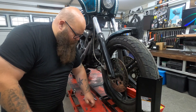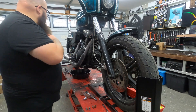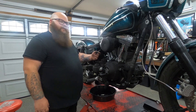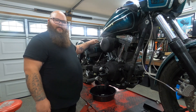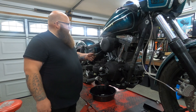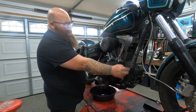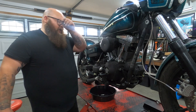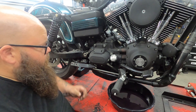It's important that you keep all your hardware together — pay attention to where it goes and don't misplace or lose stuff. We got the exhaust off. What I did was take the O2 sensor off the pipe rather than trying to feed the clip through the frame. I remember when I was putting this back together before I had the hardest time getting it fed through, so I just took it off the pipe — the front one connects to a clip up there and comes off pretty easily in one full piece. Time to take the transmission cover off.